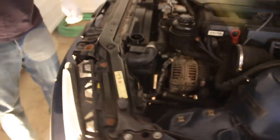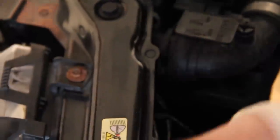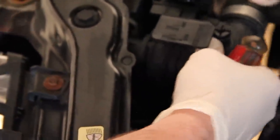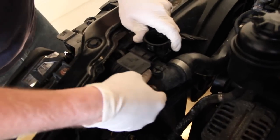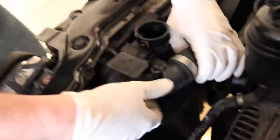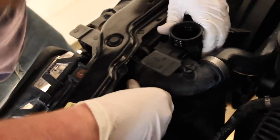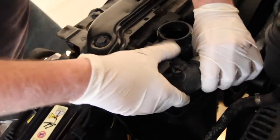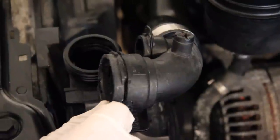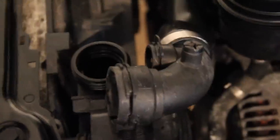We're going to do the radiator next, which is going to involve removing the top hose. Using a flat blade screwdriver, there is a little clamp on the top of the hose where it meets the expansion tank. You pry that up and wiggle the hose off. There are actually two clamps — the larger one and the smaller one. Both need to be released, then it will take a little persuasion. Once it finally lets go, pull this clip out, put it somewhere safe — don't lose it.